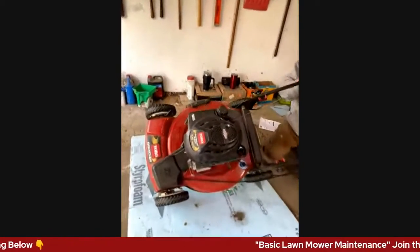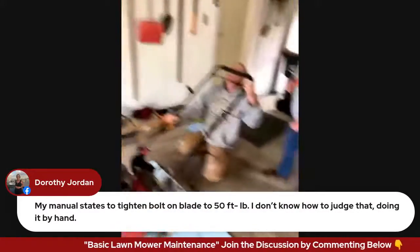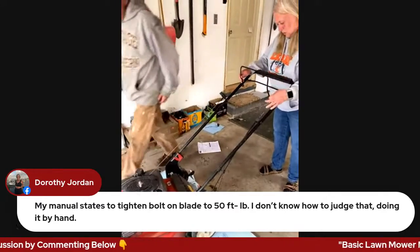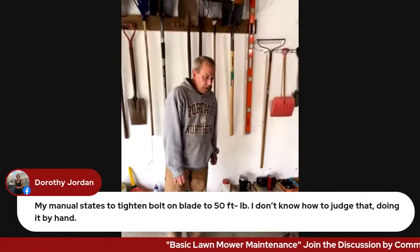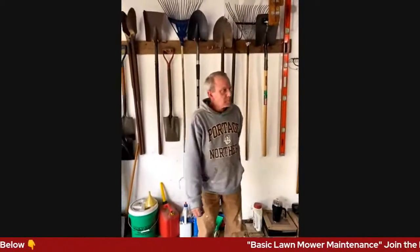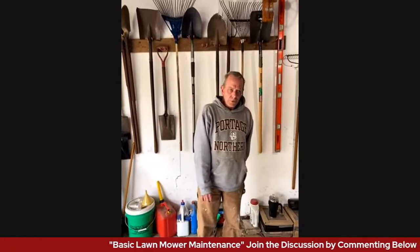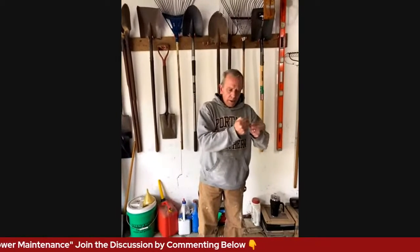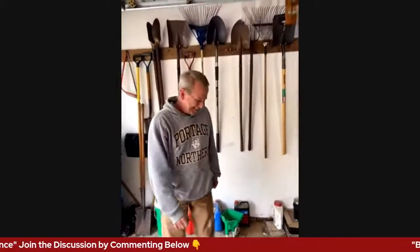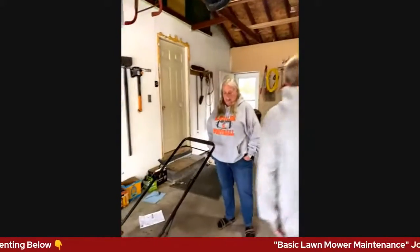My oil is drained out pretty much now. I'm going to get the oil, get my funnel. This is typical lawnmower oil — small engine oil. In the manual it's going to say what kind of oil it wants. I know this takes about 20 ounces. If you have a choice when shopping for your oil, buy the one with the wide clear side so you can read how much is in it — it's like a measuring cup. If you're not sure, just put a little bit in at a time. I'm going to put the dipstick back on, let that oil settle while I'm working on other things, then check it.